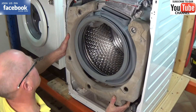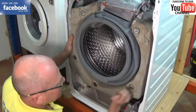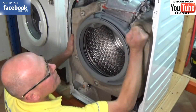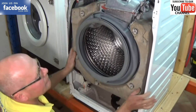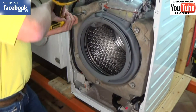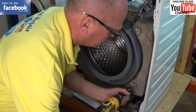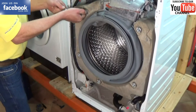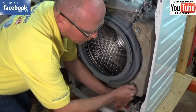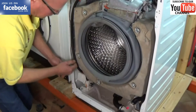This concrete block is very heavy — you might want to get a bit of help. It needs to go all the way on, so you'll need to tap it either with a rubber hammer or the back of your hand, and just make sure it goes all the way flush with the drum with the lugs clearly showing at the top and bottom. Now we're ready to fit the bolts back in — fit the five bolts but do not tighten them up; we'll do that by hand. Always work in opposites: when tightening up, do the two o'clock one followed by the eight o'clock, then ten o'clock, going down to one of the others at the bottom. Just slowly go round nipping them up — you don't need to over-tighten these, as you do not want to shear the plastic, which would be a major problem.